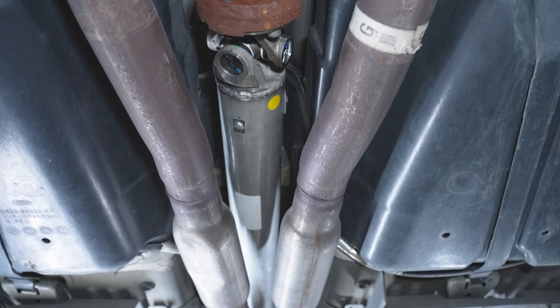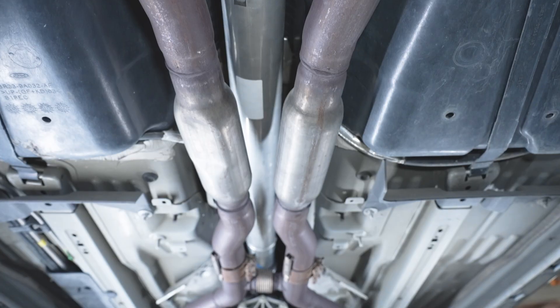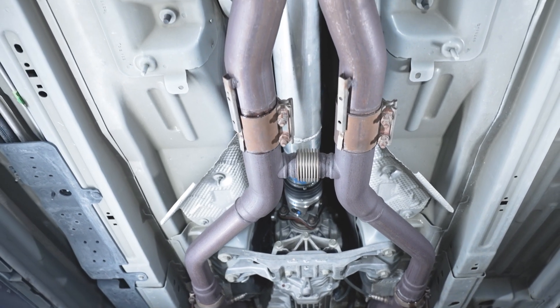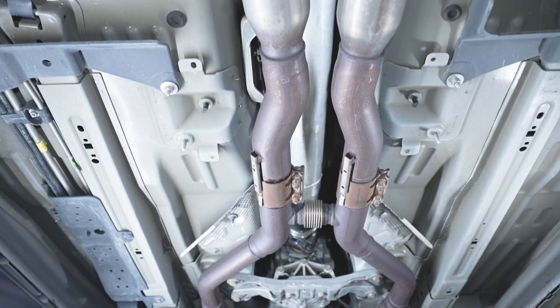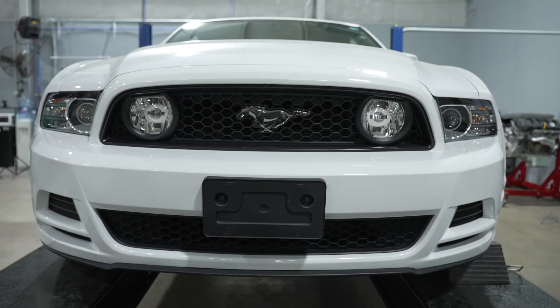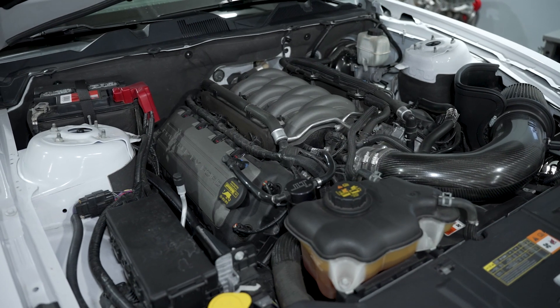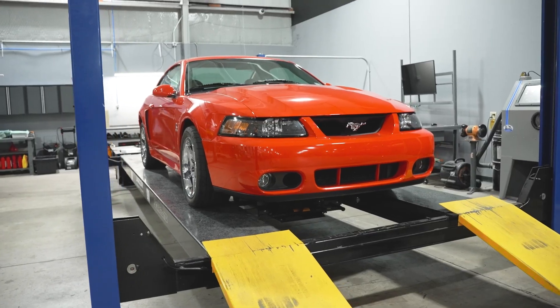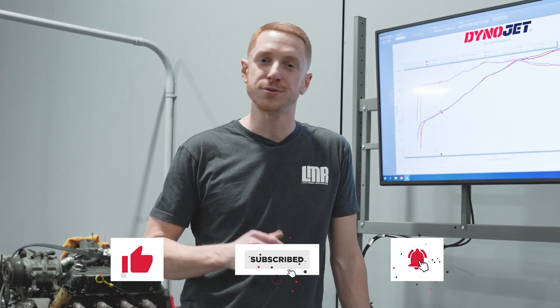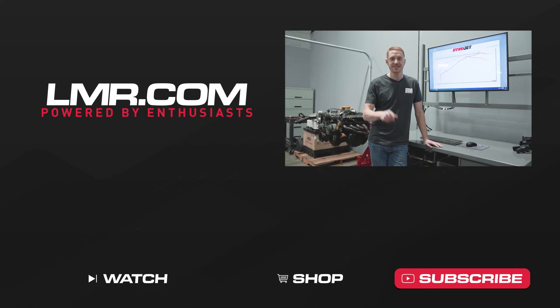Let us know down in the comments what you think of the test. Obviously it's with the tools we have available — we can't get it down to 100% scientific. The key word is the aluminum driveshaft is bringing up more horsepower because of the reduced rotational mass. Quick takeaways: an aluminum driveshaft is always a little bit better for performance because you're reducing rotational mass — a little quicker acceleration, the whole nine yards. Individual results will vary. We did this on a 2014 GT with the Coyote V8. If you have a Fox Body, SN95, New Edge, first-gen S197, S550, Lightning, whatever — depending on your weight differences, your results will vary. If you like this one, like the video, subscribe to our channel, and turn on those notifications. Until the next one, you know what to do for all things '79 to present Mustang and SVT Lightning — keep it right here with the real enthusiasts, LMR.com.